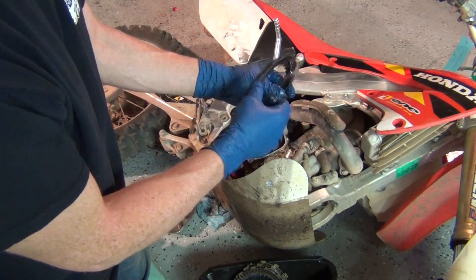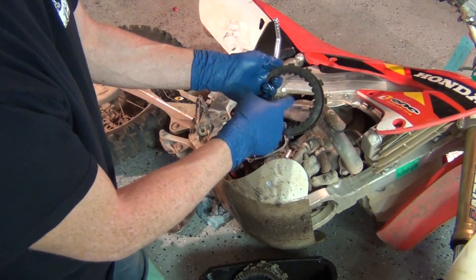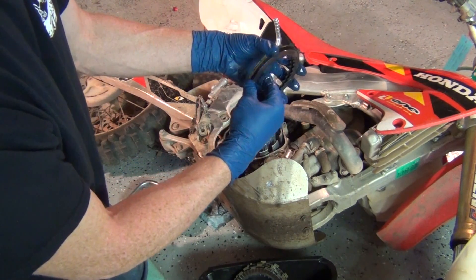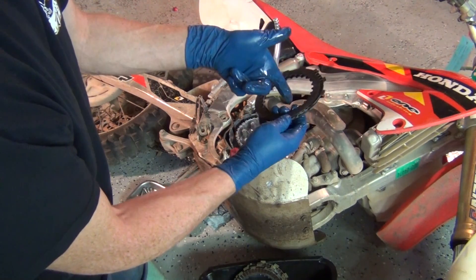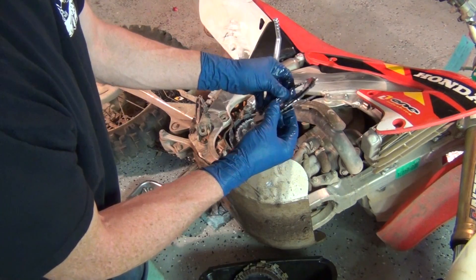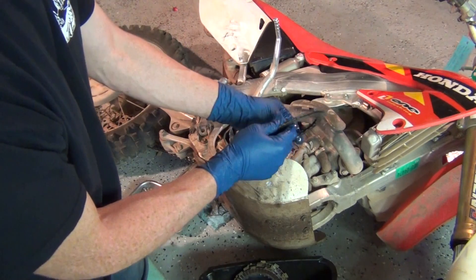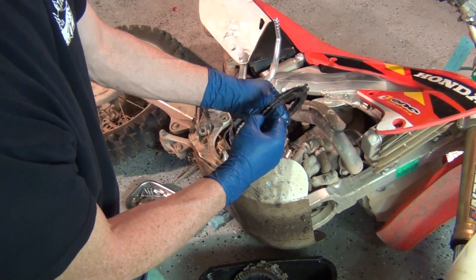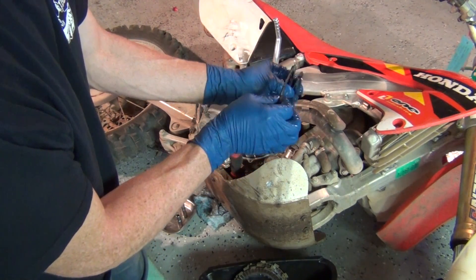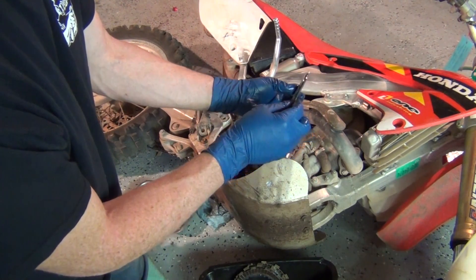This is the flywheel, and your springs of your pressure plate and everything bolt onto there. You've got little spring-loaded fingers all the way around, and the pressure plate pushes on the outside. So you have an input shaft of the transmission that plugs into the middle disc — there's a little disc in the middle with a keyed or splined connection that goes into the input shaft of the transmission. So that's pushing the clutch down, and this can spin freely as opposed to the rest. This is locked up to the input shaft of the transmission when you let off the clutch — it just sandwiches it by spring pressure.